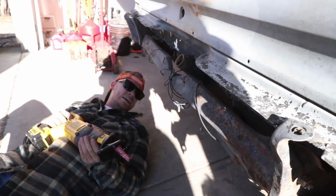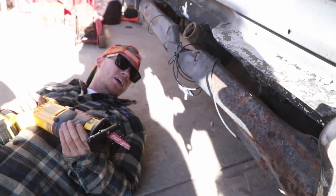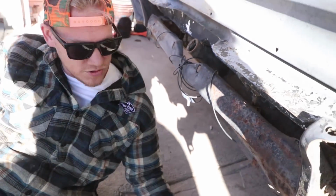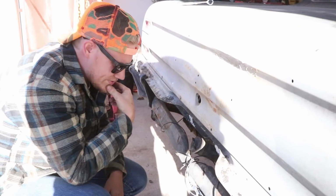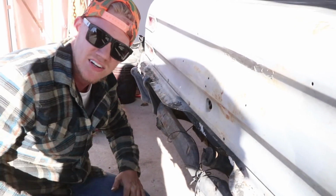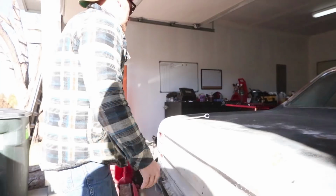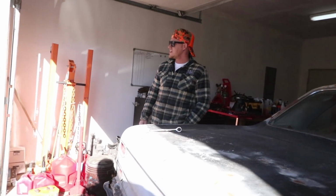Only problem is, cutting could make sparks, and you got a gas tank right here. So that's kind of scary. And I just took the fuel line off, so fumes are everywhere. Probably not the greatest idea. I don't know if I have a brass chisel or something, I could just break that thing. When you're working around gas tanks, like when you're taking the sender off, use brass if you're gonna hit it a little bit, because brass does not spark. And then you might be able to save your beard. Oh, I might just say fuck it and do it. I don't know.